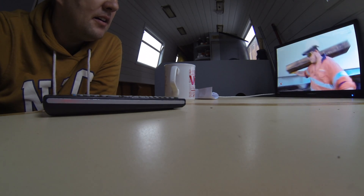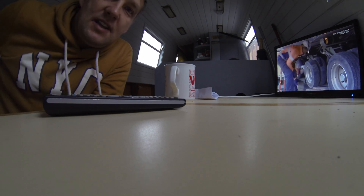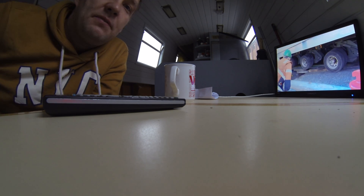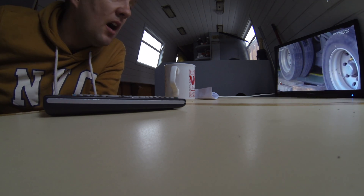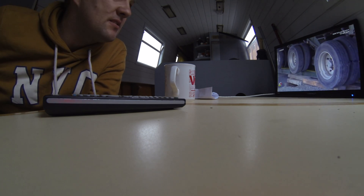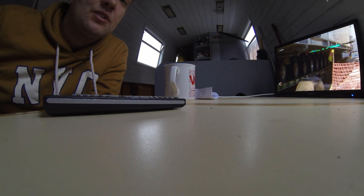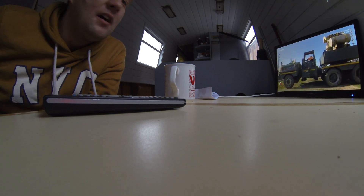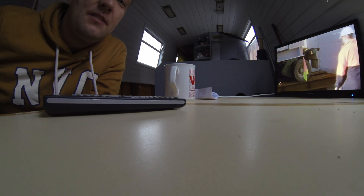I've got the telly working absolutely fine. I've had to extend the cable so it goes outside to receive the signal, but it's working completely fine off those two pins marked as 12 volt. I've directly linked to those, bypassing the whole transformer system entirely, and the telly is working fine — a lot cheaper. I'm absolutely over the moon.